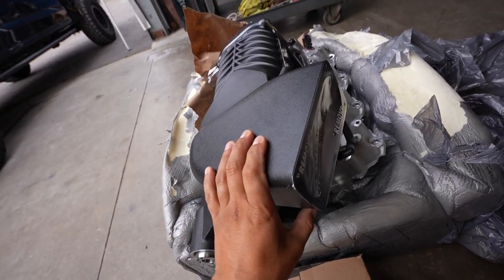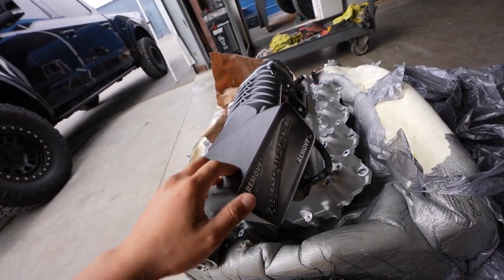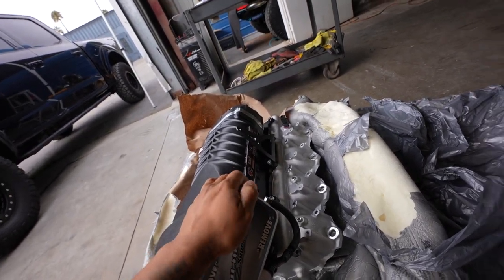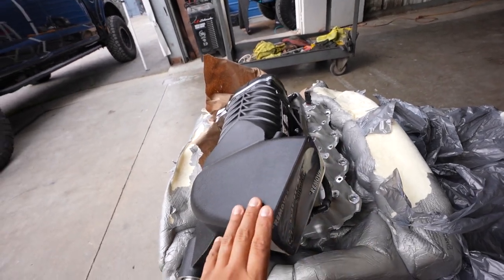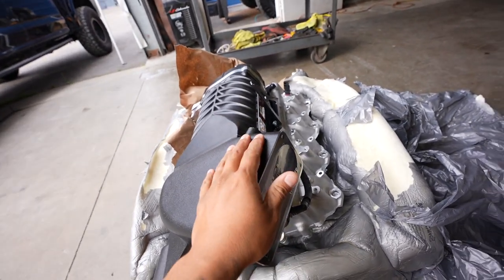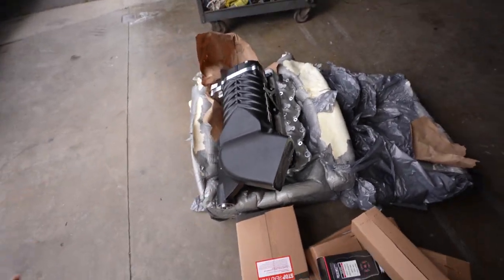So there's pros and cons for turbocharger or supercharger. With a turbo, you can run a lot more boost. You use your exhaust to spin the turbine, but there's a lot more piping. You gotta do a lot of piping, the intercooler. It's just overall a bigger build to put a turbo in a car, right? With the supercharger and with Whipple, they make it pretty simple. It just replaces your intake manifold, bolts onto the engine, everything's there. A couple modifications on the top end, but you don't have to mess with the exhaust, no piping, not a lot of other things that you run into, clearances, making sure everything fits, nothing gets hot. So if you want good power, bang for the buck, supercharger is the way to go. Turbo, you want to make more power. You can make it, but there's a lot more stuff involved in that.